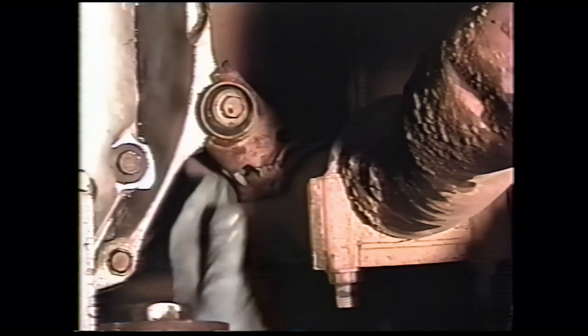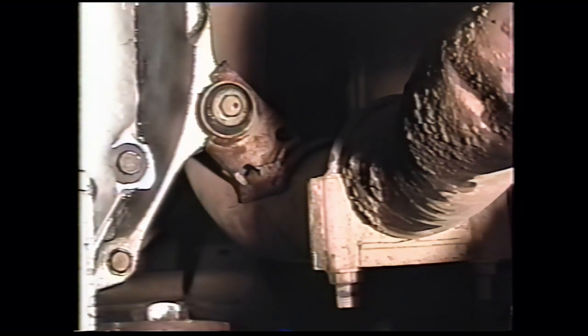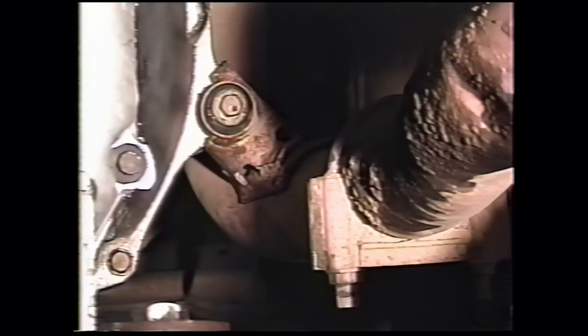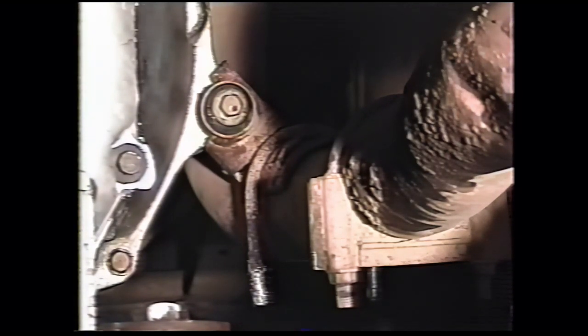After the transmission is bolted down, we can put the 8th bolt in the bell housing with the bracket for the exhaust clamp. Run that down and then torque it to 33 foot-pounds. Then install the exhaust clamp. We put anti-seize on the threads to prevent corrosion.